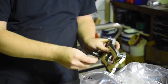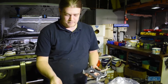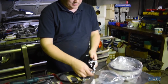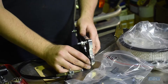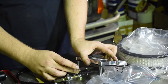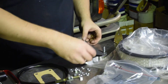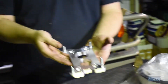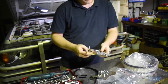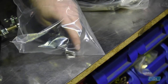We'll get the adapter plate out of the way first. In the kit, the adapter plate will come — it should go on with your base gasket under the adapter plate, and the adapter plate to the carb gasket. Now we need to just get the plate itself, so unscrew the hardware off the studs. Try not to lose them — we don't supply extras. What we're after here is the gasket for under the plate and the four socket head screws that'll hold the plate down.